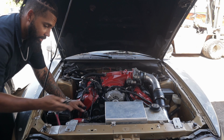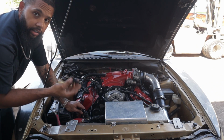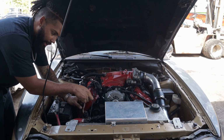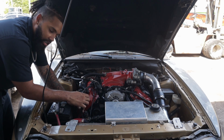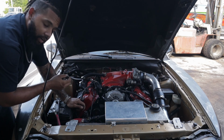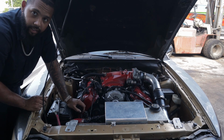All right, guys, as you can see, this is my spare crankshaft sensor, and this is the connector for it. And as you see, if I push it all the way down, I can still grab this without pressing the connector and pull it right back out. That's the issue we're having as I'm driving. This is starting to shake loose and come out, and that's very bad because this is how the motor tells where this engine is, how to deliver fuel and how to deliver spark. So we need to change this out. We need to change the cam sensor and then start it up and see if it's any difference. So let's get to doing that.